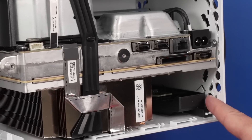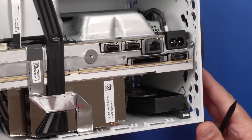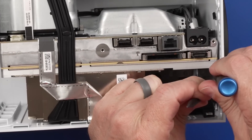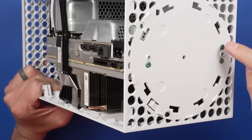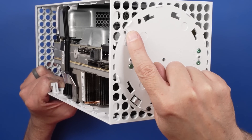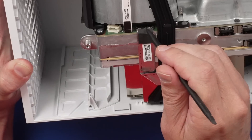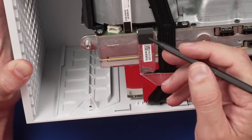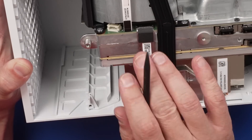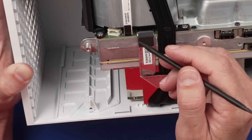To remove the bottom stand, we need to pull up on this little tab right here and then pry back on this tab. I'm going to use this pry tool to pull up while I pry back. And there we go — four screws. Interestingly, they do have the hole for the screw that would go into the disc drive bracket, which is not here on this model, but it's interesting they left that hole there. The connectors on the board appear to be the same. The bad news is this connector called the Nexus connector is very often broken by people who aren't sure how to remove the cable, but the good news is it looks the same as the previous model, so the parts seem to be interchangeable.